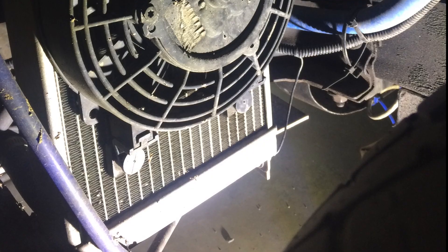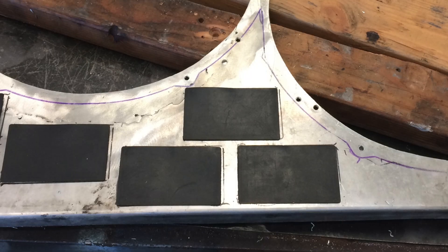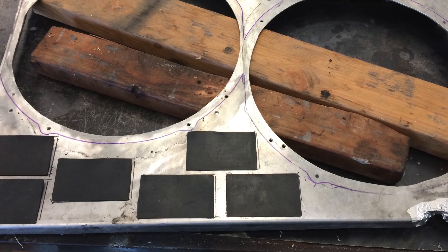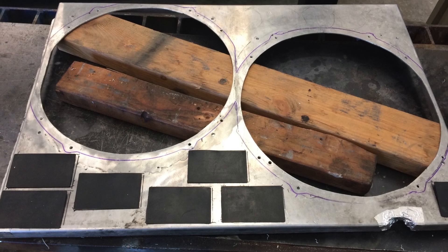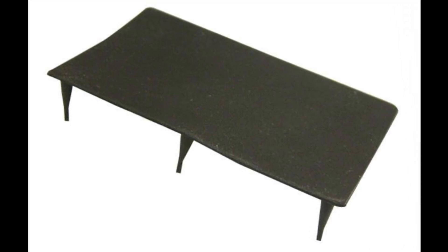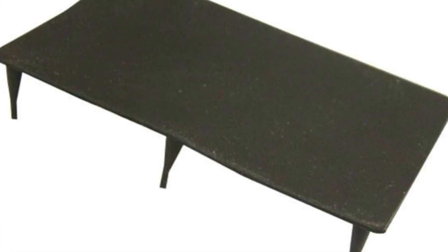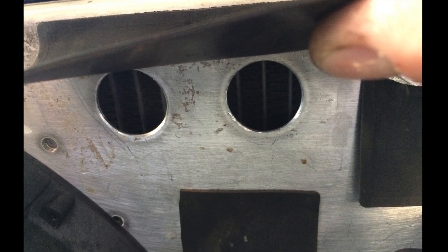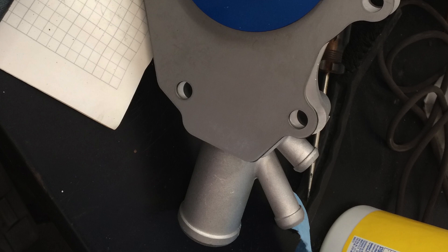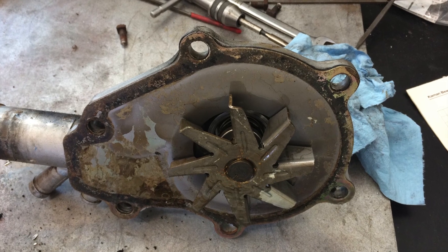There's also a thermocouple in the intake manifold, so the Haltech decides how hard to run the pump and fan based on the temperature difference between the air filter and the manifold - the greater the difference, the more it runs. When I had the shroud out of the car, we also upgraded to rubber flaps - replacement ones for Spal's own shrouds with three little rubber tabs. We made a jig to drill them precisely and added a bunch of flaps. When driving down the road, these flaps open to allow airflow through; at lower speeds when fans are running, the flaps are sucked closed so the fans pull more air through the radiator.